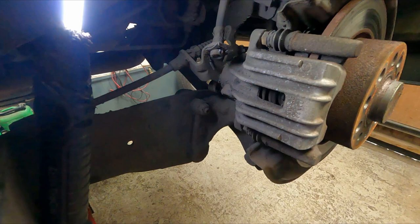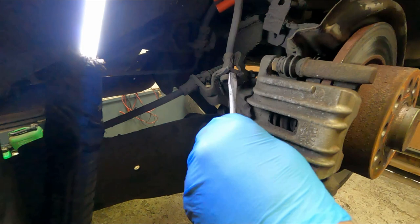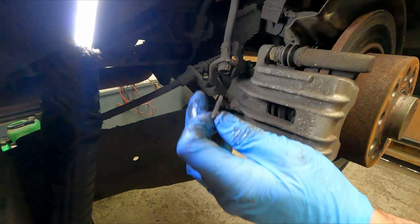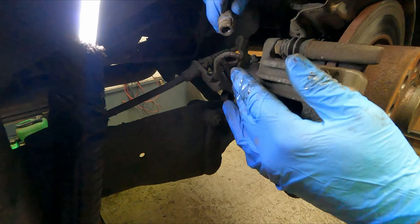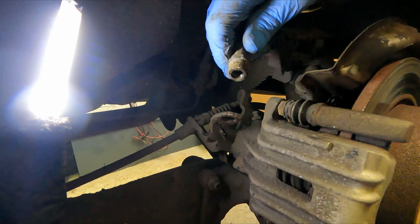Now we're going to take this horseshoe clip out, which you should be able to put a screwdriver in and just twist. And pop that out. There it goes. That just secures the brake flexi hose in place. There you go, with a wriggle that comes out. Not been out for a long time, but that's got a little notch in it which I'm not sure if you can see, it locates in a cutout in this bracket, so you can't get it around the wrong way. And as it's clamped here, we can just tuck that out of the way now